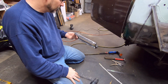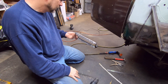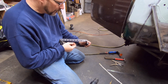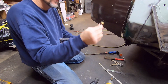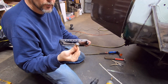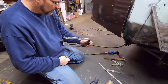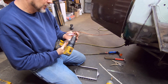Speed holes is just a detail thing for me because I'm not going for a race car - that's usually what people do for a race car - but to me it's a detail thing. Now, since this is thick metal, what I like to do after I get the hole drilled is go back and use countersink bits. These are from Harbor Freight, and they're basically for wood or to use a countersink screw, but they work pretty good here to give you a nice little chamfered edge to make it almost kind of look like a dimple die in a way. So I'm going to do that right now - these are old, not really designed for steel, but...